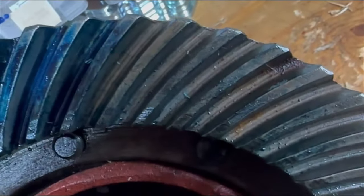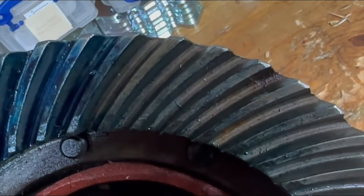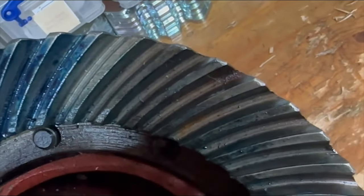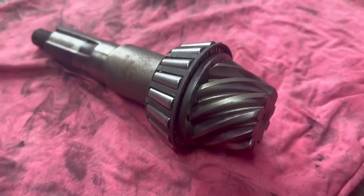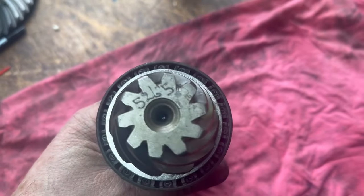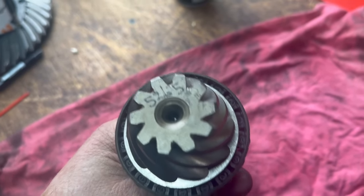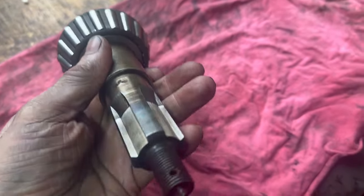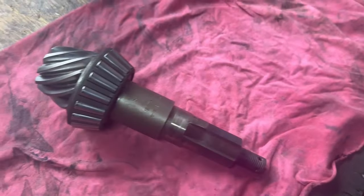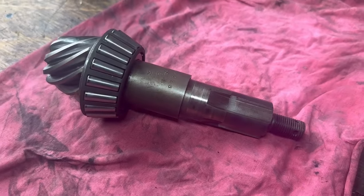Into the ultrasonic bath, and amongst all the blue check to verify the pattern — which isn't too bad when you actually look at the crown wheel itself, it's pretty damn grubby. So we're going to have that and the pinion in our ultrasonic and boil the hell out of them with chemicals to see how it looks. Here is the pinion that's come out of that diff — it's sat in my ultrasonic cleaner for the best part of three or four sessions and you can see the number on it, which is 5265.